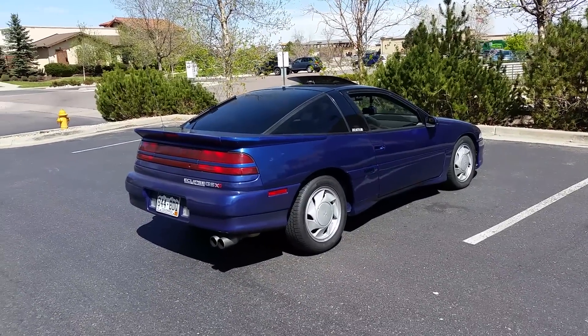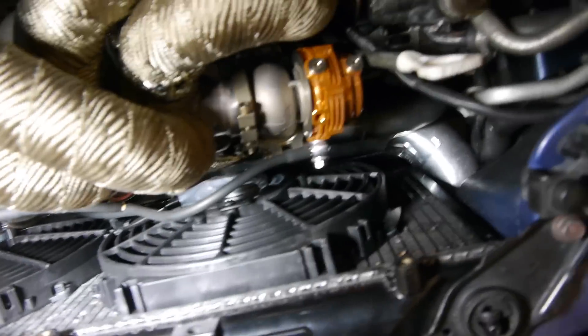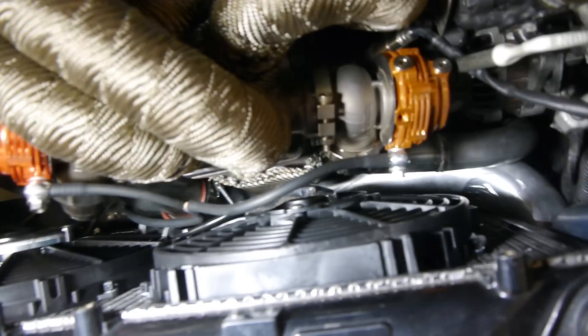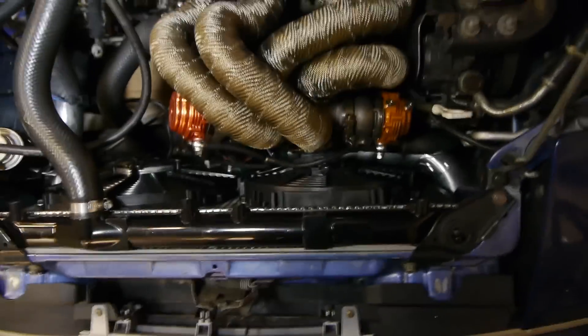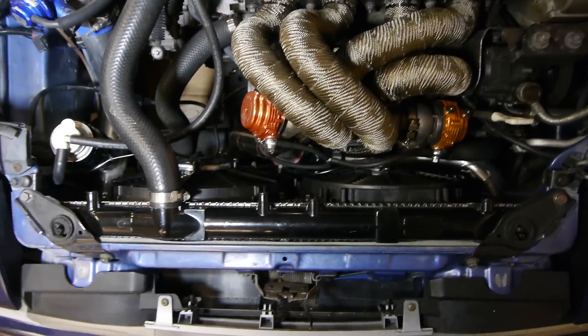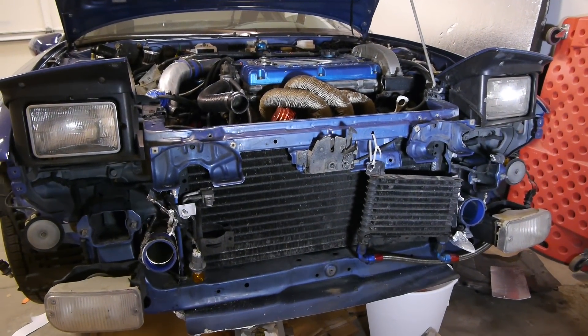Drove to work and back and it melted anyway — although not nearly as bad as before. There's still evidence of slight melting around the fan, which means it's not going to last. The Tial wastegates seem to not be leaking at all, so those were definitely the problem before. But it's just too hot over there — there's no way a cheap fan will survive multiple heat cycles that close to the turbo. So we're pulling the radiator again, removing that fan — I'm just not going to be able to run a puller fan on that side. So I added a pusher fan instead, sealed it back up, and in conjunction with all the ducting and the quality SPAL puller fan, everything was working beautifully. I also heat-wrapped the downpipe while it was in there and that definitely helped with temperatures.